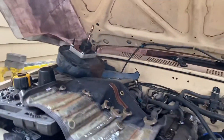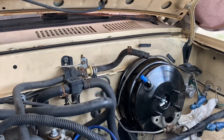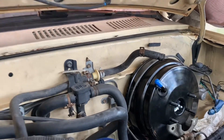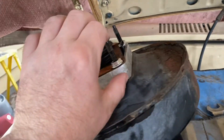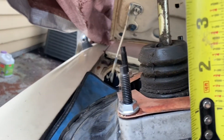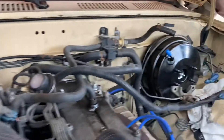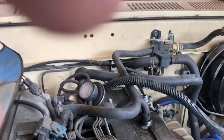If you have the stock single diaphragm booster for the pickup and you're swapping to the dual diaphragm, you'll have an aluminum spacer that you need to remove to get it to fit. The studs are roughly two and five-sixteenths inches long, and the new booster isn't really much longer — so if you put that aluminum spacer on it, it's not going to work out. Just remove the spacer and keep it with your old booster rather than finding out the hard way.